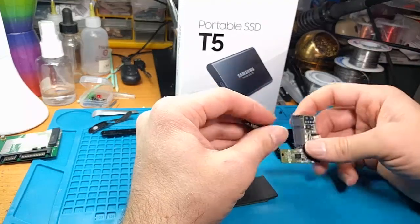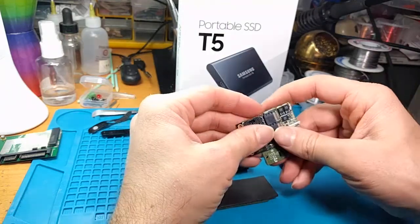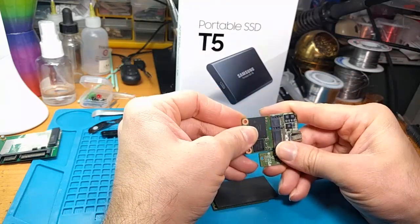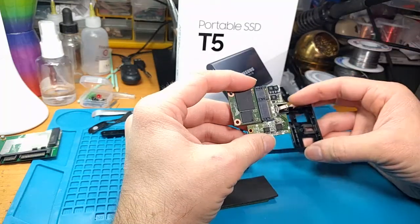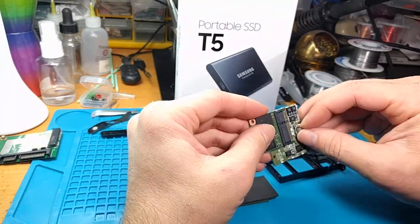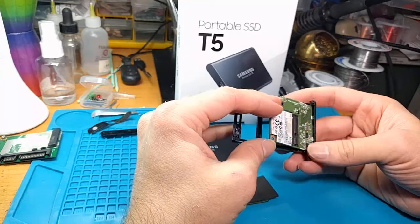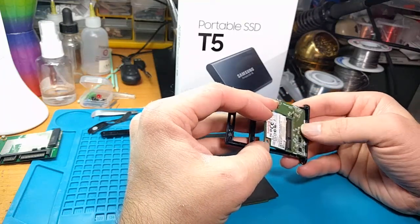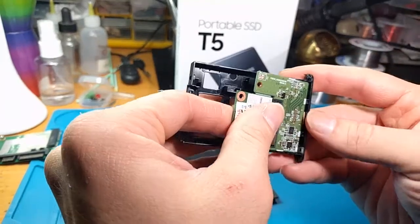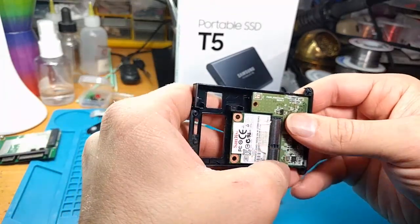I'm going to put this back together and show you the reverse process for how this works. My laptop originally came with a 24-gigabyte SSD — really tiny. That plugs in without the usual stress support mount; instead there are two plastic clips it has to go under, as well as clips on either side. The trick with this is to just go really slow, and those will clip.